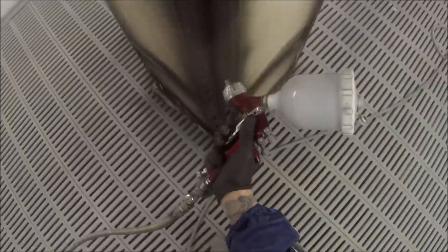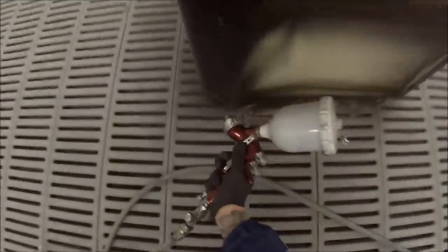And as for adhesion on the center section of that roof, where you see me painting now, that was actually already painted, so all I did was a quick scuff down by hand, and it didn't need any primer, so you didn't see me put any of the etch or the plastic primer on, because it's a different substrate, as I mentioned at the start. So it's important that you start getting the hang of identifying what you're painting.